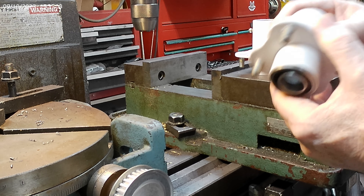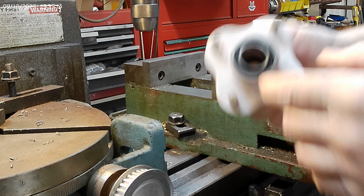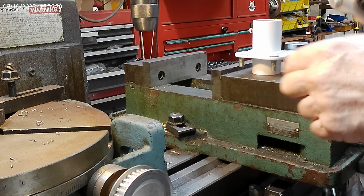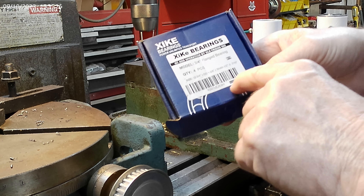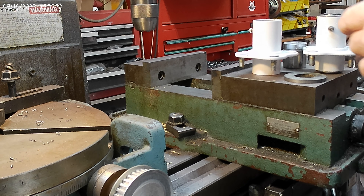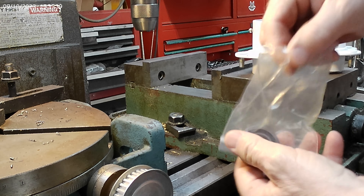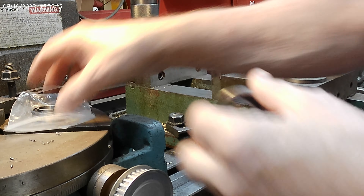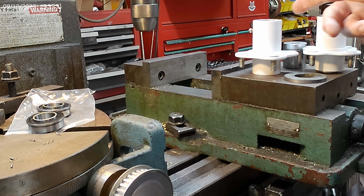Getting to these front hubs — I've already put one together to replace the bearings in these things. According to Jim Jackson, you buy these steel bearings — machine steel bearings — supposedly they do say TRC. They're machined, not pressed like the ones that came out of it, and they look pretty nice, so I'm going to press these things in.